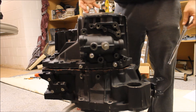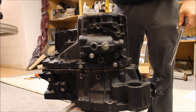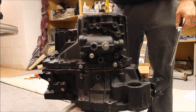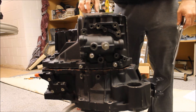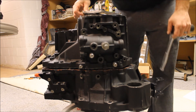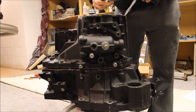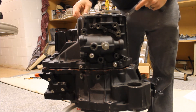I've already taken my shafts apart and put them back together with all different gears and stuff, and it ended up being the exact same shim. I took it apart again, used a different input shaft and everything, and it ended up being the same — it's just switching that second gear. I've come to think, and maybe just double check, but I think this shim is more just adjusting the machining of the case versus your actual shaft. The thing with your shaft is always going to be pretty much the same, and this is just adjusting the case machining. Because I have never had to switch it.